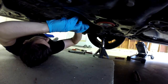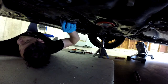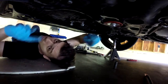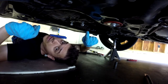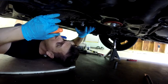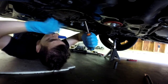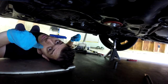I'm not going to tighten everything all the way yet — I want to temporarily fix it so I can realign the mount if needed. I put in this bolt first to make sure the mount doesn't go anywhere. The mount was out of alignment, so I got a big screwdriver and moved the engine slightly up and toward the front of the car. I plugged the screwdriver against the lip of the engine block and that moves the whole mount, allowing you to adjust it.